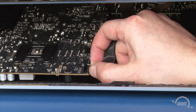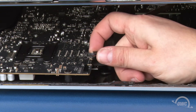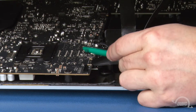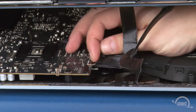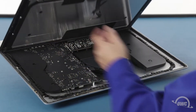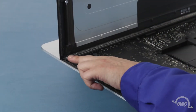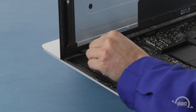Inside near the top, you'll need to detach two cables. For the first, simply slide it out of its socket by its tabs. For the second cable, first lift up on this plastic tab to unlock the connection, then slide the connector out. You can then angle the display the rest of the way up and remove the adhesive holding the bottom of the display. Simply grab the tab on each side of the screen and slowly pull it towards the center until it comes free.